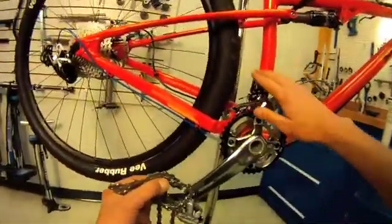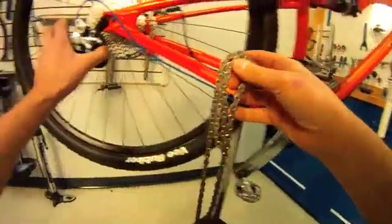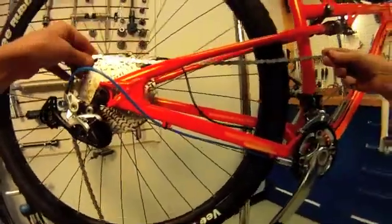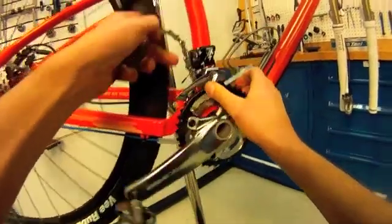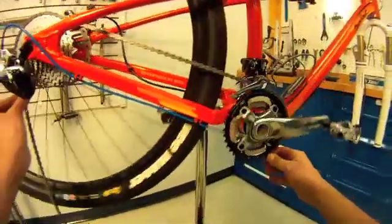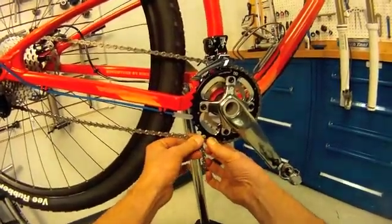To do this, we're going to use our cable and shift up to the large ring, but we're not going to shift the rear. So we're simply going to lay this chain in — not connect it right now because we know our chain's not the right length, so we're not going to push any rivets in or out just yet. So the largest-largest would be like so, as if it were a one-speed.